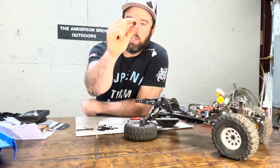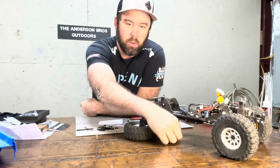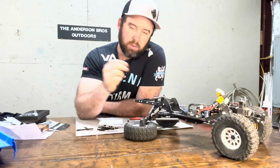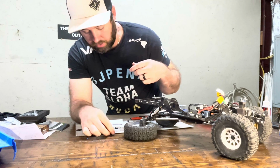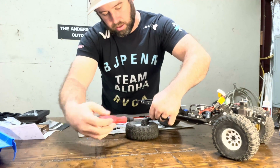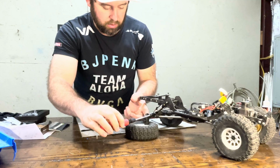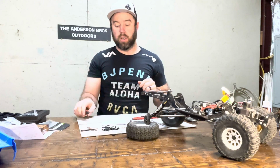Another note, you see that there are pistons here. They do have different holes in them, so this will dictate the pace at which the piston will contract and rebound. However, we're going to use these as spacers because they're here, and why not? So just be a temporary fix or solution until I find a more permanent one. We have the first shock on there.